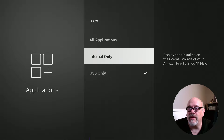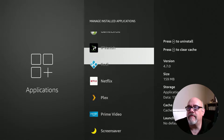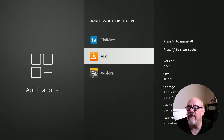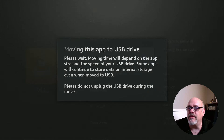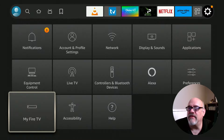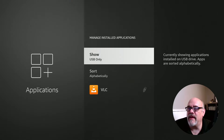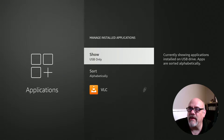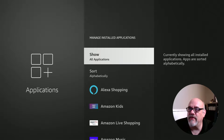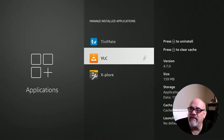Going into what's installed on the USB drive only shows nothing yet, and internal only shows all the existing apps. Some apps can be moved — for example, going down to VLC player and clicking on it shows an option to move to USB storage. Let's click that. It takes a moment. Now when you go back into storage and manage installed applications, you can see VLC has a little USB drive icon next to it, confirming it's stored on the USB drive.